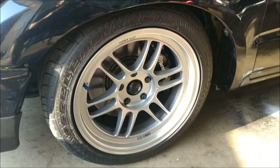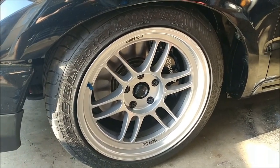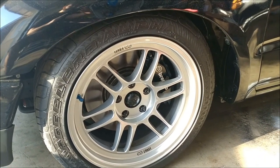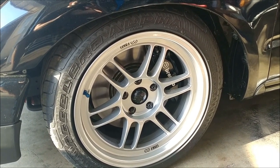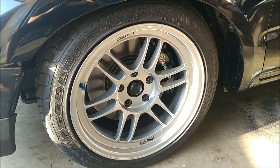These will require a minimum of a 17-inch wheel. Anything smaller and the caliper is going to rub for sure. These are my 17x9 RPF1s and they clear perfectly. They're a little close, but nothing to be worried about. So anything above a 17-inch is going to work perfectly.